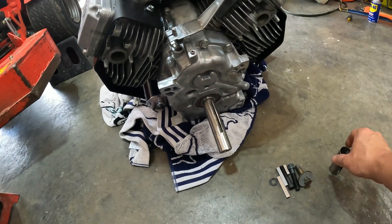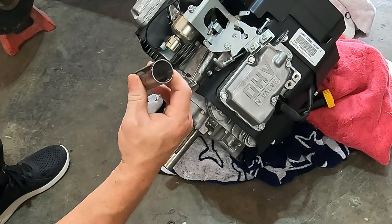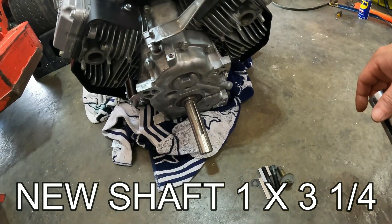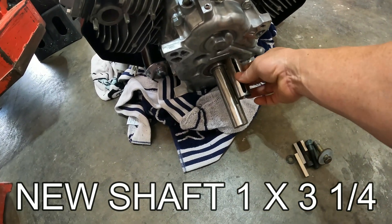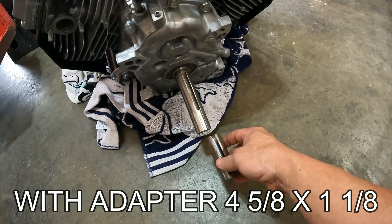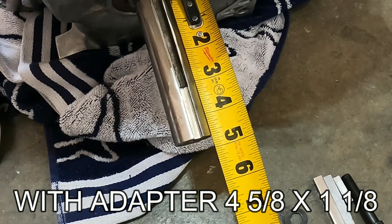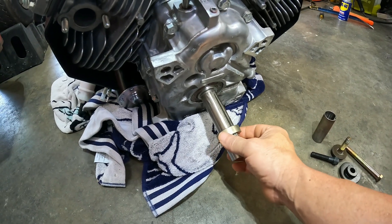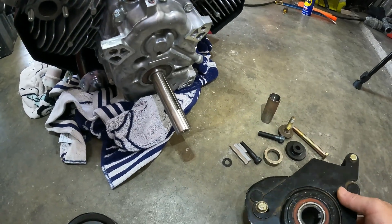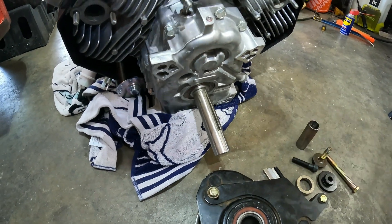So when they were trying to put the engine in, I told them to get an adapter sleeve, so they got this one. It's one inch to one and one eighth. Same exact model number — FS600V — ended up having a one inch shaft and maybe three inches. I found this little adapter sleeve extender and now the new shaft length is four and five eighths. And every time I try to put this ring on, it would get stuck right here with the adapter. And then I try to put the PTO on, it would get stuck about right there — it'd only go about halfway on.